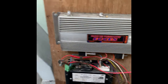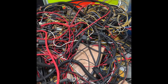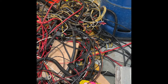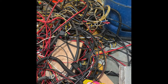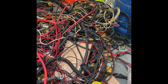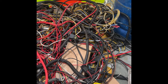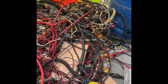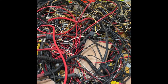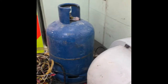The air suspension on this ambulance was also controlled by the genesis system, so when I took it off, the air suspension stopped working and I couldn't pump it up. As a temporary measure I've wired the compressor and the pressure switch directly to the ignition, so when I turn the ignition on the compressor comes on if the pressure switch tells it to. That's working fine for now — I'll eventually get a switch to raise and lower it as I want.